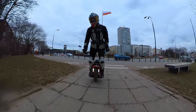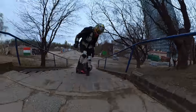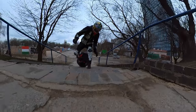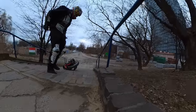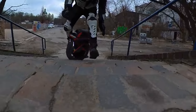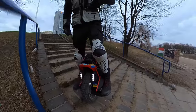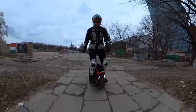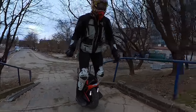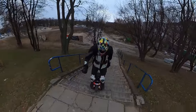The wheel can naturally do stairs, but I don't advise doing that because you might break it. You can see that the wheel made a pedal dip — pedal dips usually notify you that you're overpowering the wheel. This is sort of like the last resort of the wheel not turning off by itself and trying to limit the rider. It's happening quite a bit here, and you'll also see it later in the video. When going up slowly on those stairs, I'd also feel quite a bit of a lack of torque, and there are sometimes some weird clunks in the motor that are a bit concerning.